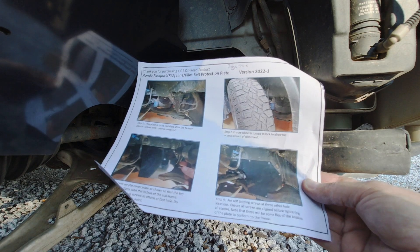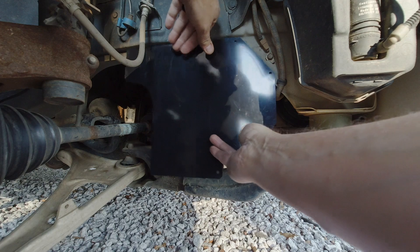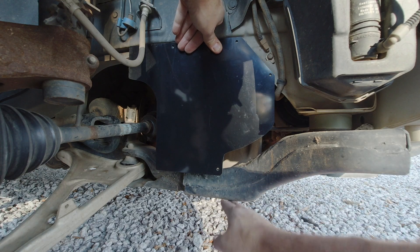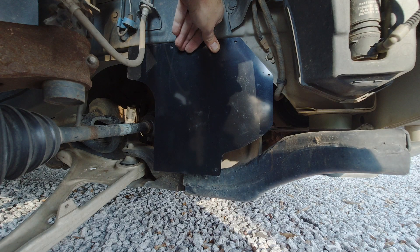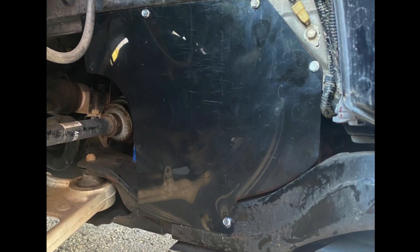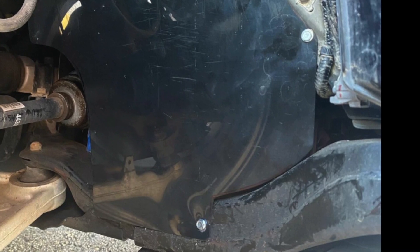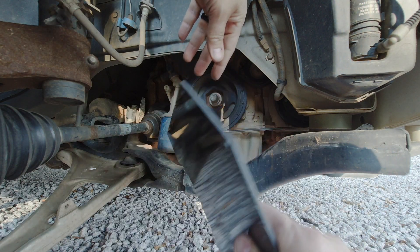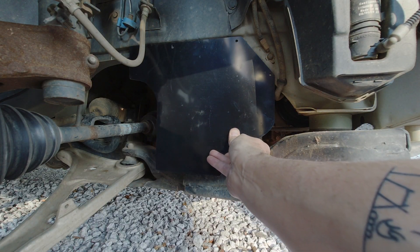Now on this bottom one here I have a one-inch subframe drop, so you guys are going to be able to drill right in here. But all I'm going to do is zip tie it around there — if it gets hit it'll be cut, but at least it'll protect mud, water, and stuff flinging up and hitting that serpentine belt as well as the filter. I'm going to pause the video so you can see what it looks like fully installed without a one-inch subframe drop. You'll see that front part is following the subframe — it's made of a very flexible ABS. I'll put the specs in the description, but yeah, I think it's pretty awesome.